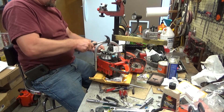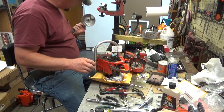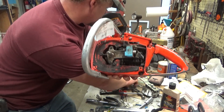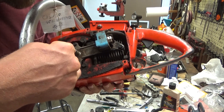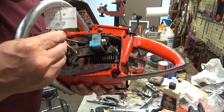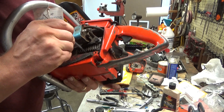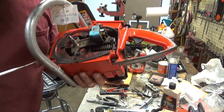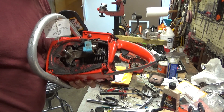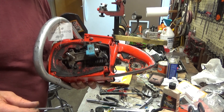This one is going to be stubborn. There we go. Now that's not as bad as I thought it was going to be — I did actually expect a little worse. Now you can see that air passage I'm talking about. Right back here — there's supposed to be a nice gap between there that opens up to the front of the saw and to the drive case side. So what I'm going to do is clean this thing out completely, get all this crap out, make sure the fins are open on the cylinder. They don't look terribly obstructed, but there is gunk built up on them, so that's going to mess with heat transfer. I'll blast this out, replace the fuel line and the grommet, and go to Home Depot and get some True Fuel so I don't have to mess with the tuning.